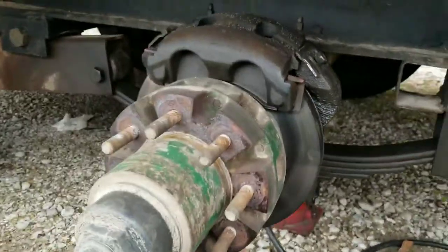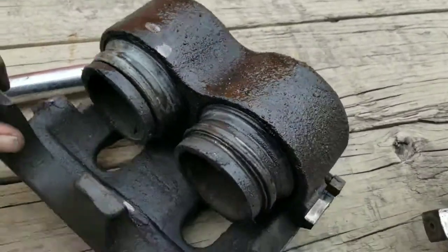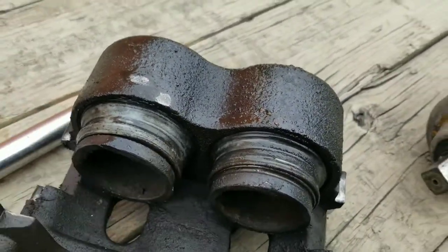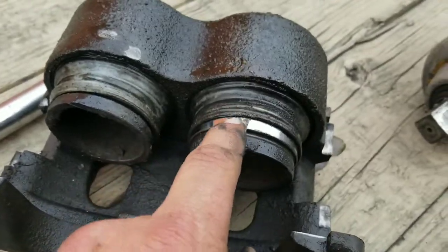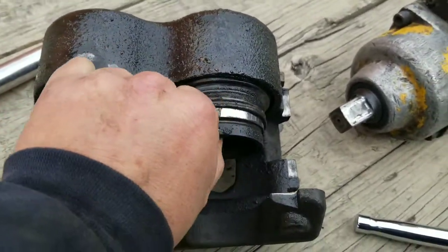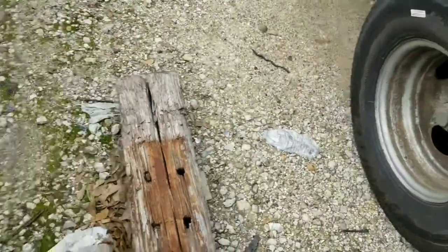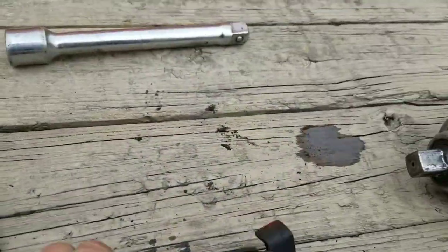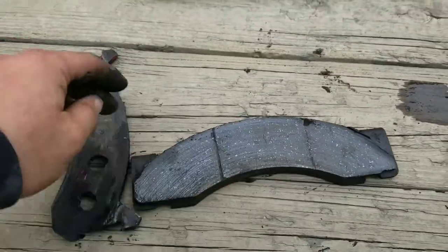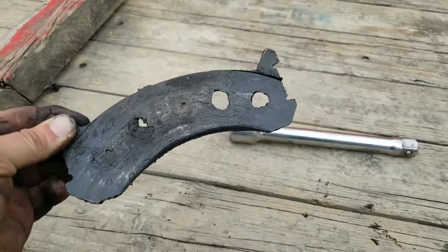So it's gonna get a complete new brake job on this one. You can see how that back brake shoe was wearing on there — tore up the caliper pistons. And of course this is leaking really badly. That piston is shot right here — I can just pull it out if I wanted to, but I'm trying to keep it so it doesn't pour out all the brake fluid. The front brake shoes definitely need to be replaced, but at least they weren't tearing up the rotors. But this one — let's just say it's seen better days. It's toast.